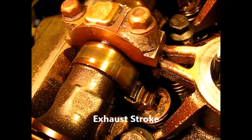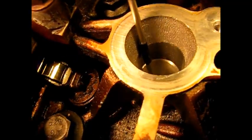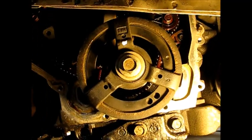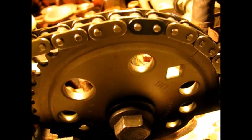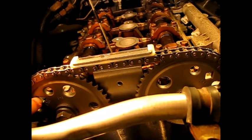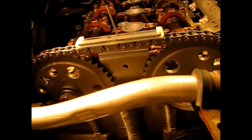Our next stroke is going to be exhaust — we're coming back up again. Exhaust cam activating the exhaust valve, going up. We're all the way back up, now made two revolutions, 720 degrees, and we're right back where we started — seven o'clock on the exhaust valve, five o'clock on the intake. Intake sprocket back at two, exhaust back at ten. This is back in the correct timing position. We've confirmed everything stayed in order during two revolutions of the engine. We're ready to put this car back together. Thanks for watching.